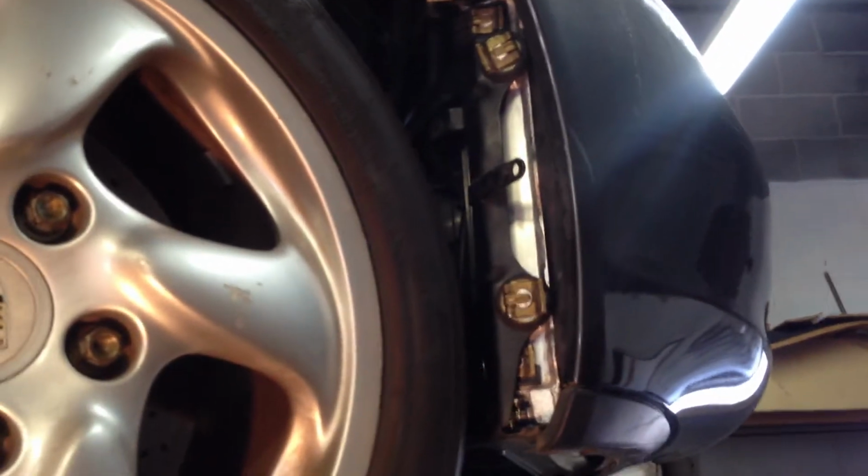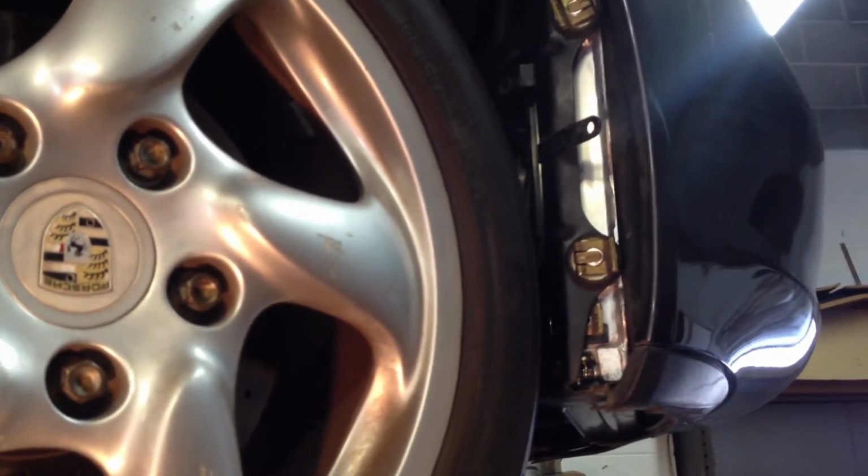That radiator does want to rub right on the steel support there a little bit, and also on the front left of the radiators. I will get the bumper cover back off next week. I've got the car stuck in the air with other cars underneath it right now, so I can't pull it down, but that's something to be aware of. You might want to put something in there. I just cut up some of the old rubber hoses and put those in to keep it from rubbing, because that steel will eventually rub through the aluminum on those radiators. But overall, the installation was pretty good.